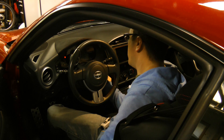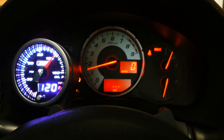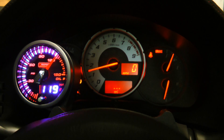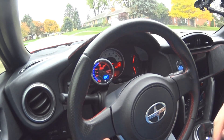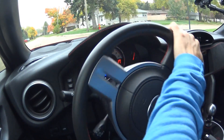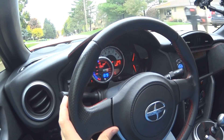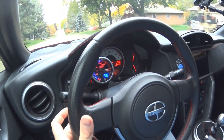Let's take a look at the oil pressures on a cold start. I'll give you a quick demo of how much the oil pressure fluctuates on throttle. The car's been at idle for about 10 minutes and the direct injection mode has switched — you can hear the chirping from the high pressure fuel pump. This is why cold starts are really tough on cars. The oil is cold, it's thick, and the thicker the oil you use, the higher your oil pressure on cold starts — and that's typically where all your wear happens.